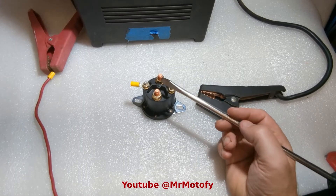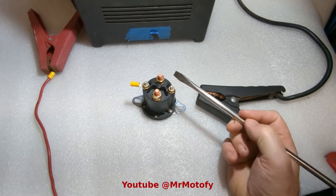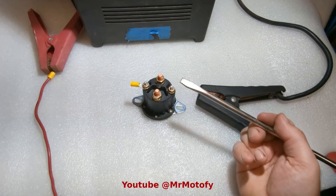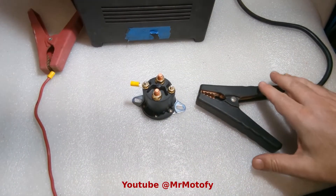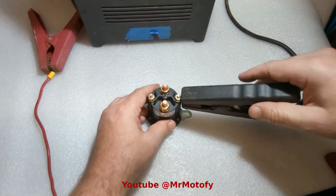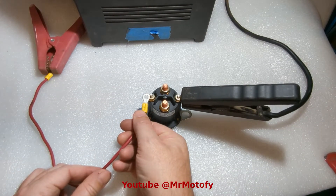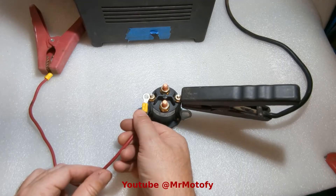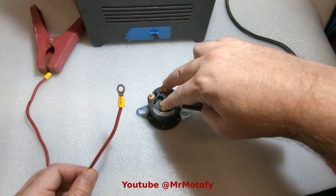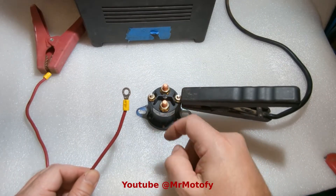In some applications, the switch will be done by the negative. So your controls are basically positive and negative. Very basic testing is: you put negative to one control terminal, positive to the other, and you'll hear it click. What it does is switch and control the contacts between the two main battery posts — you get continuity.